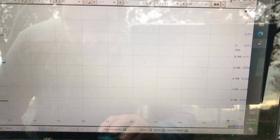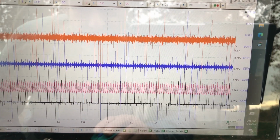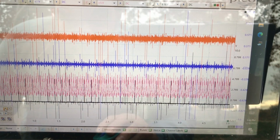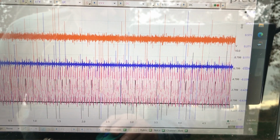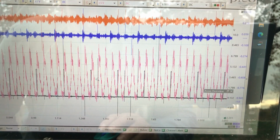Okay, I'll stop the scope and we'll roll it back and talk about it. I'll take one channel at a time. Let's get a little more vertical zoom on pink. Those are our vacuum pulls. I will pull them up and zoom in on it, and we'll just talk about a fire cycle. And we want to concentrate obviously on our microphones. That's the reason why we're here, to diagnose the noise.